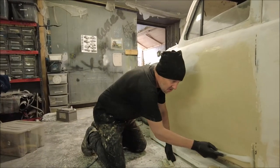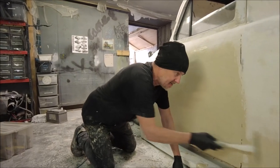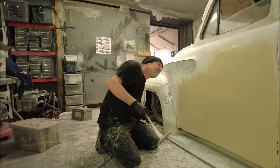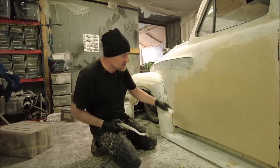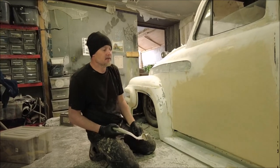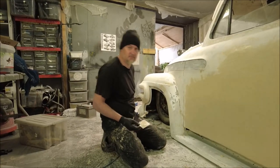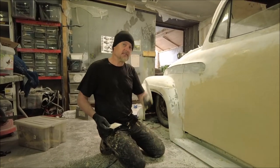Can see there, we get a lot of filler over a really large space really easily, and like I say, there's less of those sort of transition marks between the filler spreader. Now, it's not like a glass finish, but once it's been sanded, I'll be really close and probably just a few bits off of the spreader after sanding that, and that will be nice and straight. I'm ready for the next stage. It's not primer, paint, more sanding, sanding, more sanding. But anyway, gets it to this spot a little bit quicker, thanks to the squeegee.